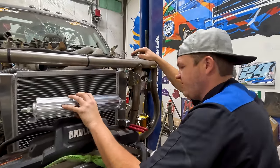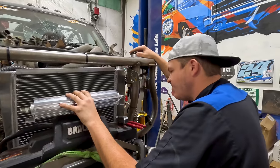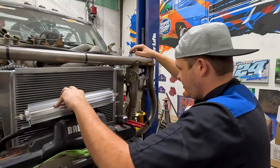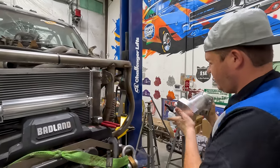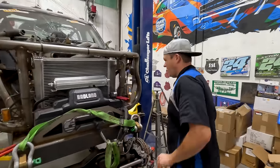Maybe if we bring it out here, we can still put a fan in. Yeah, I think that's what we'll do. So we'll make some brackets off each side of the bars. We'll mount that. It'll be below the reservoir and I think it'll work. Yeah. Okay, now I've got it figured out. Light bar eliminated, reservoir ready, cooler ready, orbital valve ready.